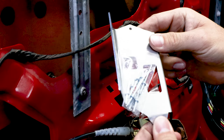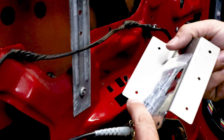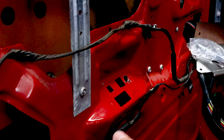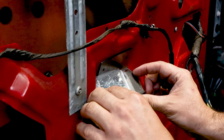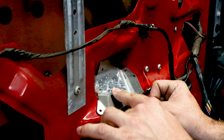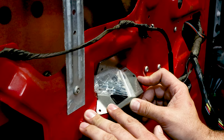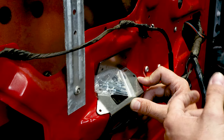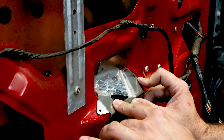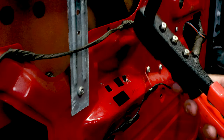This is what you'll see when you get it — it comes with the rivets you're going to need, taped to it. You'll know if it's a driver or passenger by the laser cut D or P in the upper corner. It just kind of sits up here and all these holes line up with the factory holes. We send rivets because self-tapping screws can vibrate loose going down the road. Just grab a cheap rivet gun from a local tractor supplier or Harbor Freight — nothing special needed.